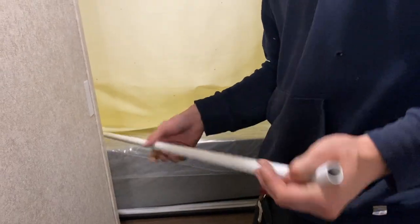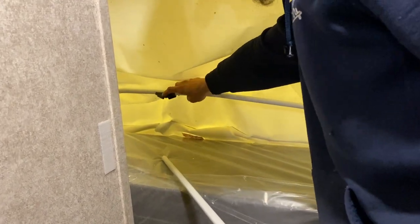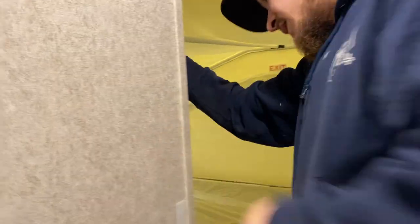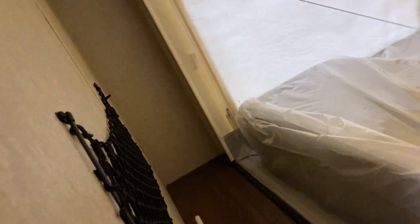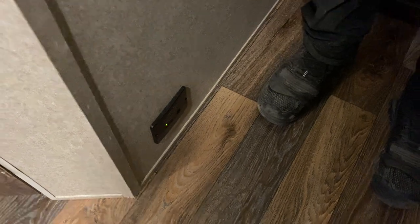Into the back bunk room. You'll get these support bars — notice one end has a little bend in it, which goes toward the middle of the trailer. Inside the tent ends you'll find a little bar; flip that up and there's a small black box in the center with a nub that you line up with the end of the bar, then flip it up and push it out. On the ceiling are little claws — get the bar as tight as you can and tuck it in there, which opens up the bed end. Once the mattress is out of the plastic, this end flips over to fill in the gap. The fan-light assemblies clip up, and you've got an outlet on the wall. All three bed ends work exactly the same. Straight down from the thermostat is your LP detector — it sits on the floor and if it detects gas, it goes off just like a smoke detector.